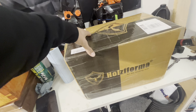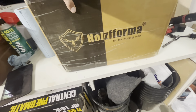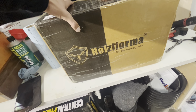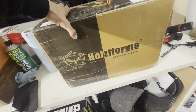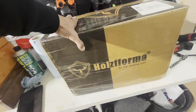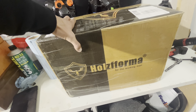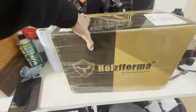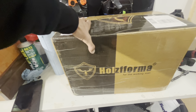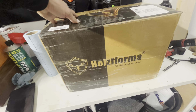Probably not on the timing advance — we'll see. I'm definitely gonna try to clean out the carb, do the standard stuff, make sure there's no weird things going on. We'll check the little metal feed hole — it tends to tear sometimes if there's debris or metal that wasn't burred perfectly. We'll go through all that. It's not going to come with a bar and chain, so you guys will have to do your own thing.